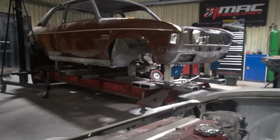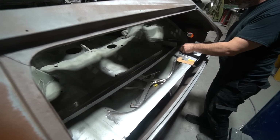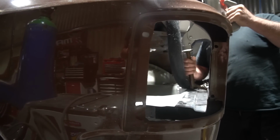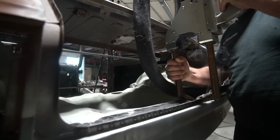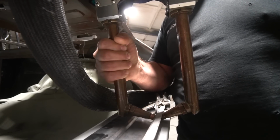To that end, Bobby has been pushing forward with the fabrication on this again this week and has made serious progress. The rear boot floor has been terminated to the boot lid shut, if you like, the boot shut across the bottom. I think last week we had literally just mated the body shell onto the top of the floor pan. And that left all the edge finishing to do and the closing of gaps around the areas where the actual joint was made. One of those gaps was the rear of the boot floor. There's a 60 or 70 mil section across the back of the boot with an upwards flange on it, which we then spot weld to the forward side of the seal channel on the boot aperture. So that's all done. Bobby's finished all that.